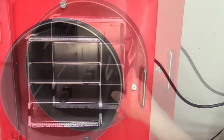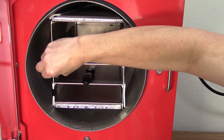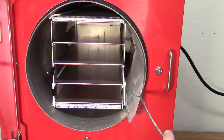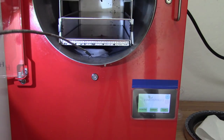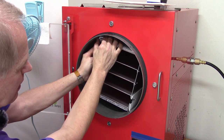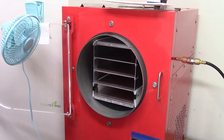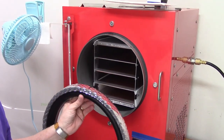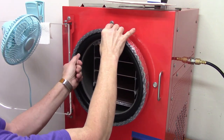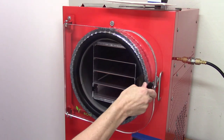Let's see if we can get the other side. Hopefully my timing will be better on the rest of this series, because I don't really like taking this out and doing it this way, but in a rush you can. I'm going to rotate this rack a little bit so any water on the shelves or on top will pour off. Put it back into position and get the seal back on. I have a line at the top so I know where it is. I hold it at the top, put it next to that little screw, get it started very gently, and then use the door itself to finish pushing it into place so it's nice and even.